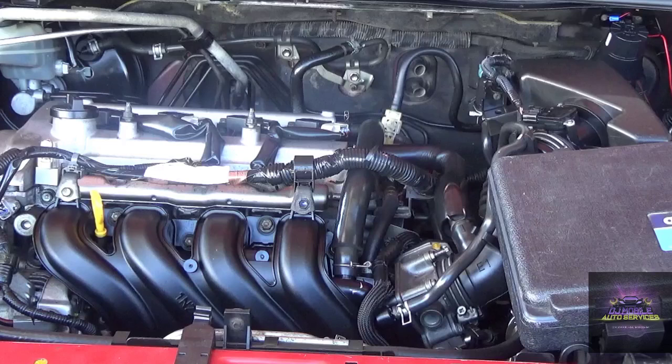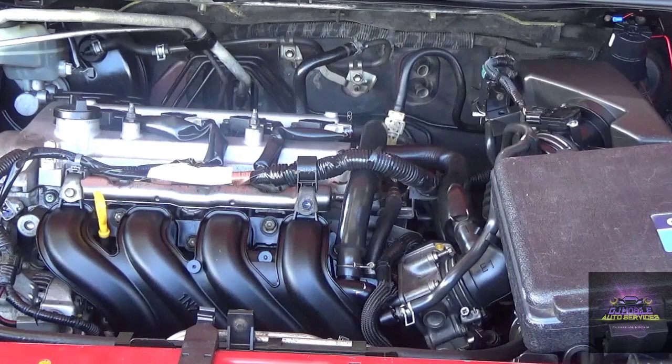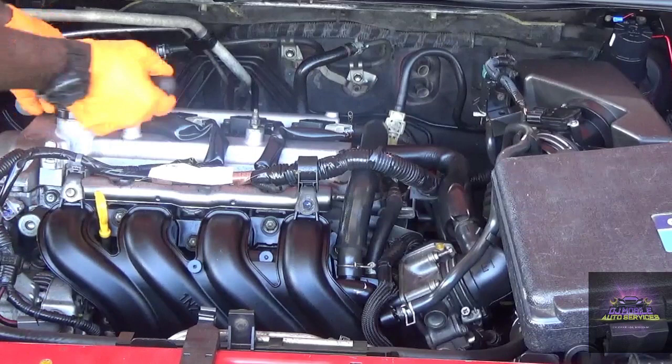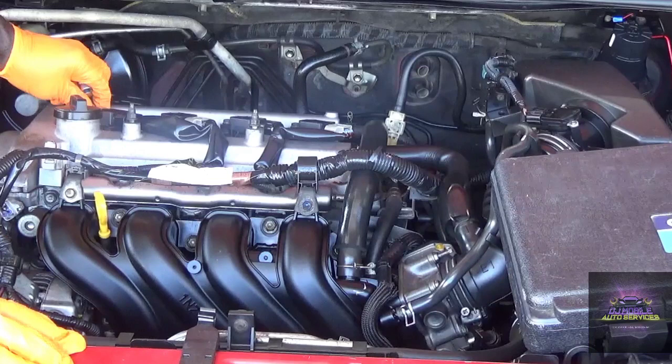the cylinder. As I said, the vehicle was running, so I'm not sure if they kept cranking, that they washed the engine, basically washed the cylinder by keep cranking the vehicle. I'm not sure. Let me just see what's going on. Alright, let me just take this key off. It's kind of annoying. All right, so what I did first was a compression test. Now I'm gonna do a relative compression test. My apologies. So this is a manual compression test I'm gonna do here.